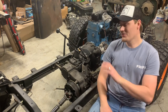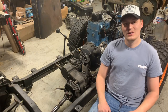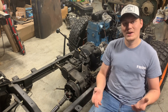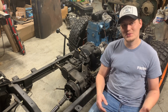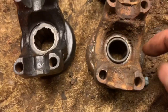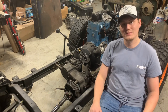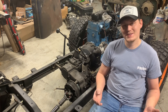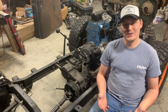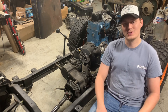Ultimately, what I discovered: the front yoke had a bunch of corrosion, a bunch of pits in it from just sitting over the years. I went to my parts transfer cases and started pulling those yokes off - come to find out all those were pitted too. I also discovered that later model transfer cases have an O-ring groove cut in the yoke to keep oil from seeping around your threads and past that washer and nut. My final fix was picking the one with the least pitting and putting it back in. It hasn't leaked since, but I think once I start driving, I'll see oil start coming back out.